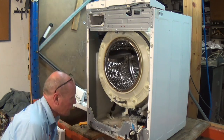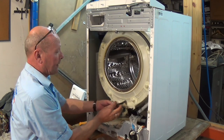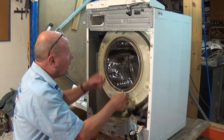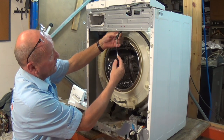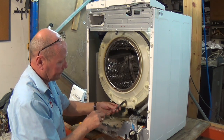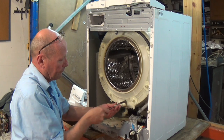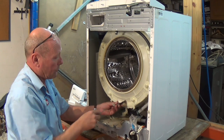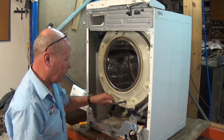Now we've got to clean up all the surface before we do anything. It's worth cleaning these pipes to make sure there's no buildup — as you can see here there's a load of crud built up over time, and the same in the bottom one. Just make sure this is completely clear because this is what gets rid of the water at the bottom of the seal and also helps to stop your seal going mouldy.